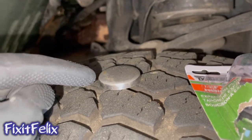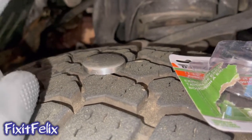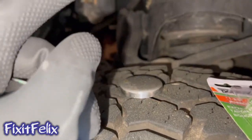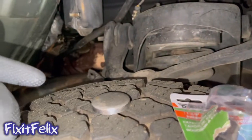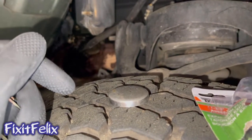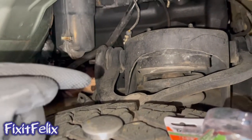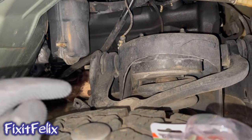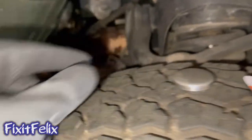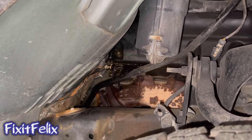It turns out this thing is called a freeze plug. The reason mine broke or came out is because my truck has a water leak — it was a small one, so I didn't put engine coolant in it. I live here in Houston, Texas, and there was a big snowstorm, and it didn't have any antifreeze or engine coolant. What happened is the water inside froze, and that's why this freeze plug broke. As you can see, it's nearly impossible to put in without removing the engine, so it's gonna be a really tough job.